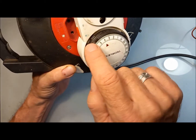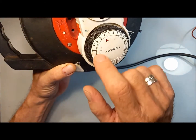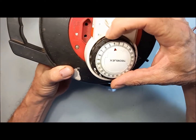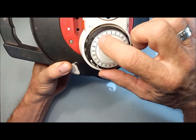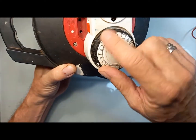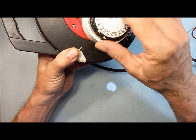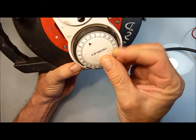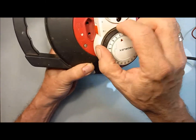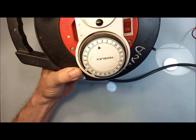So for the fridge, I have it like it runs for half an hour. Every little thing click is a quarter of an hour. There's 4 of them in 1 hour. So then you decide how long you want the thing on and how long you want it off. I actually put 2 in, one for the defrost heater and one for the motor. So I'm going to open it and see how it looks inside.